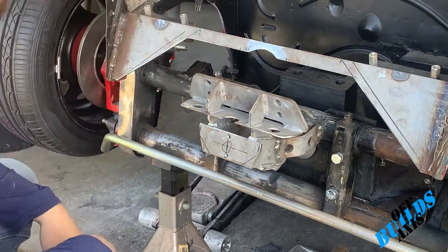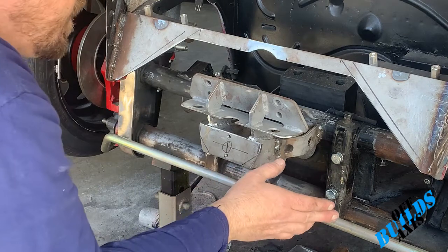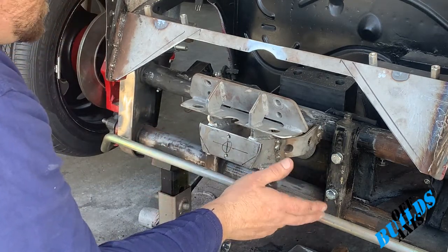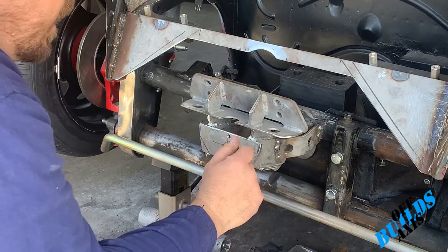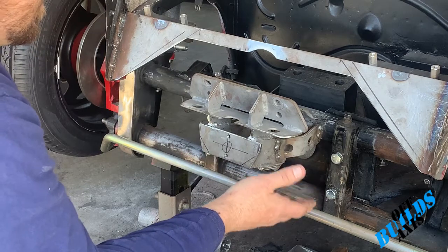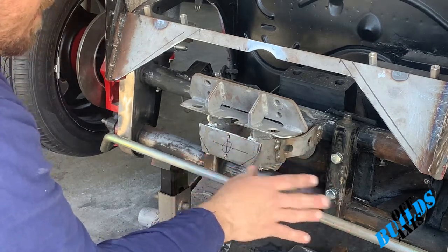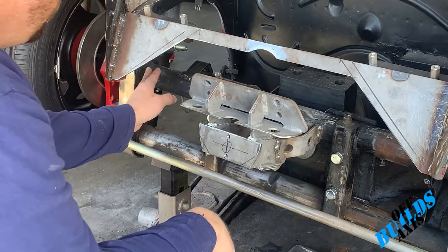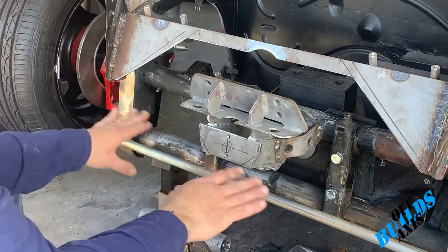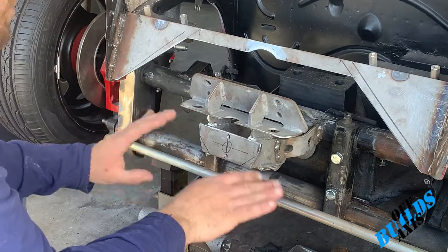Alright guys, so this front beam was a little bit more involved than just cleaning the grease off. After I started cleaning it off, I realized there's a lot of overspray, and I just wanted to clean it up and make it look a lot nicer, get some of the rust off of it. So what I wound up doing is I scraped off as much grease as I can. I'm sanding down the beam to smooth out the paint levels so it doesn't look so jagged.